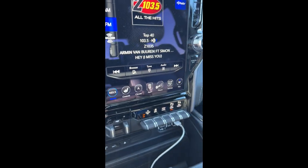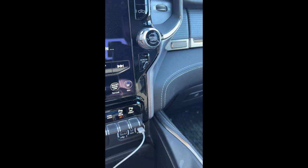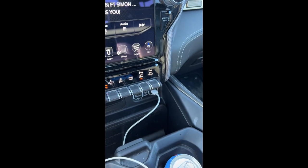Amazingly, we fixed the issue — no noise. I've hit a couple good bumps and this is the quietest I've heard this truck in a long time. Pretty cheap fix if you think about it — it was $45 Canadian for the sway bar bushings. It looks really good. I can't believe just a couple chunks of rubber make that much noise. I do all the poly bushings in my street rods but it's amazing how well it works on this vehicle. The poor old truck keeps going — now we've got to look into the rusty oil pan, which is really bad. I phoned them and they said it was a chip, not coming under warranty, so I'm going to talk to the dealership I bought it from.